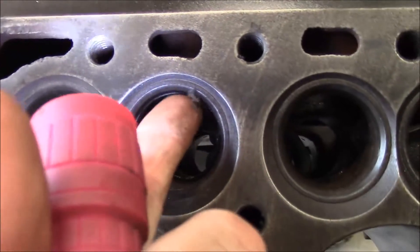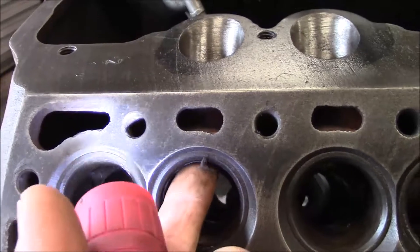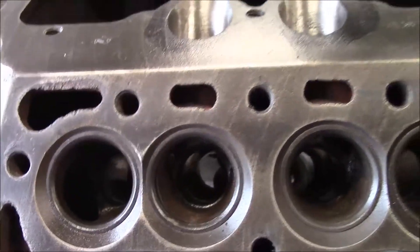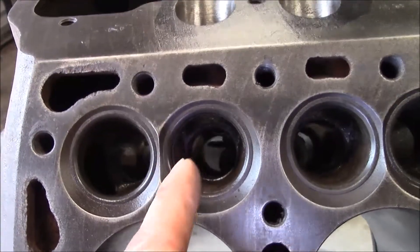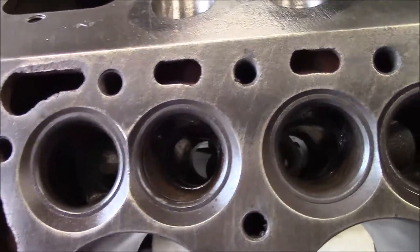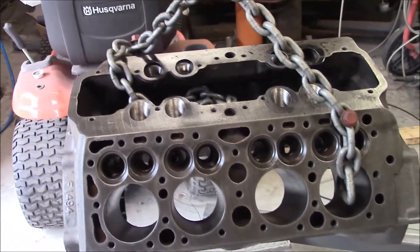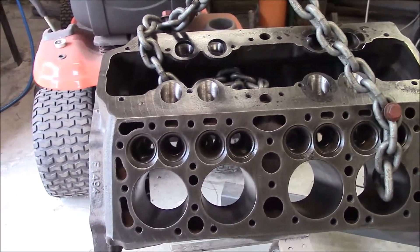On the intake ports, there's kind of an abrupt right angle right here. If you round that off, it helps the intake gases come into the valve a little easier. I did that on all the intake valves also. I'll tell you what — it's kind of scary grinding on a block when you know there's water passages there. You don't want to go too far and hit water, then your block's ruined. So I was really cautious; I just rounded them off a little bit. I didn't go race crazy on this block, but I did help it a little bit, and I learned about porting, so that was kind of cool.